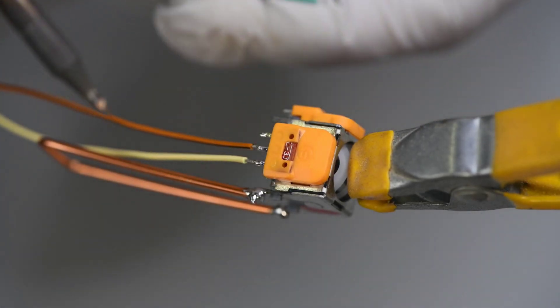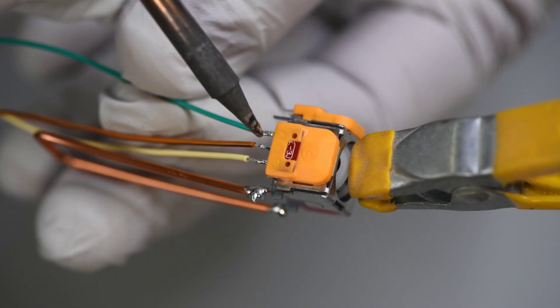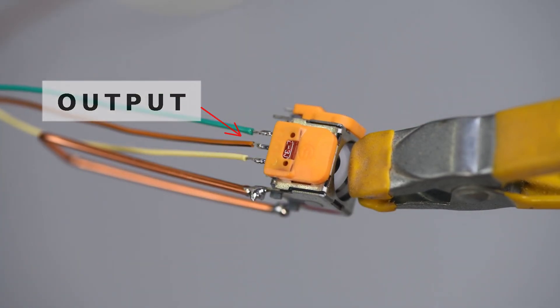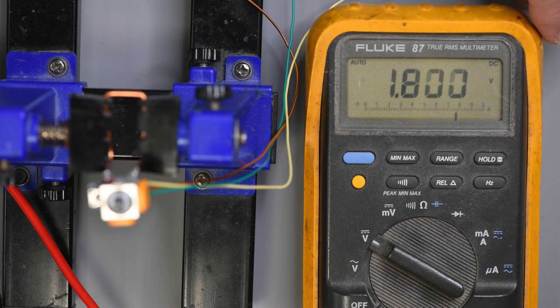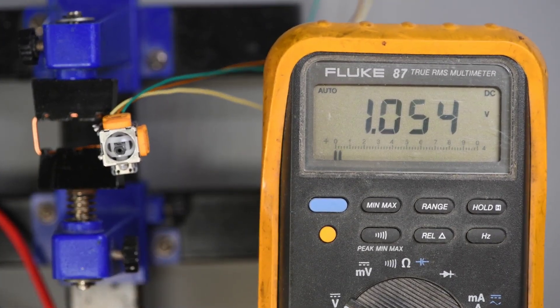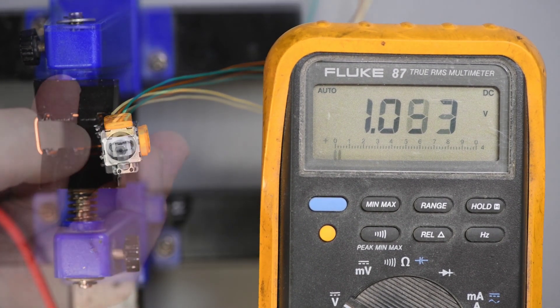I think this is due for an electrical test. I know the DualSense joysticks run off of 1.8 volts, so 1.8 volts goes to this pin, ground is this pin, and the output will be on the center pin. I have 1.8 volts going to the positive pin of one of the joystick Hall sensors, and the meter is connected to the output pin. Perfect would be 0.9 volts — so it's a bit off. Let me do a bit of adjusting.